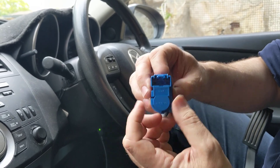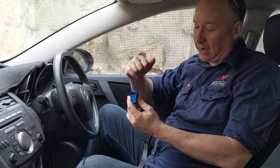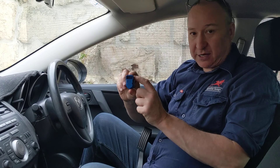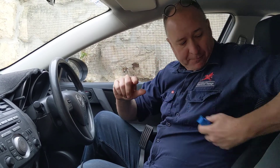The one I've taken out of my wrecked car has four pins — one, two, three, four. So the original switch with only two pins would not work with cruise control; you need the four-pin version.